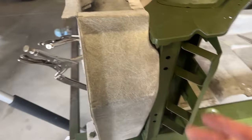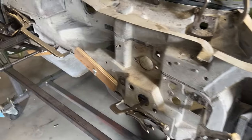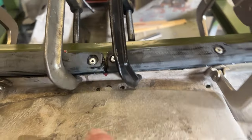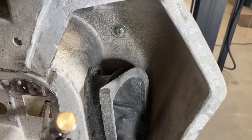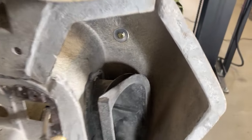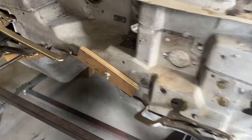I had some issues with this being located left to right in the proper spot because I replaced the lower windshield and lined that up with all the dash bolts, which made this hole here off a little bit. I had to make that more of an oval so the hole would match up because I had to move the firewall over to match up with the original holes and where the washers were. You can see that washer's right around the same rust ring as the old washer, so it's in the original location — which is what I was attempting to do. Really happy with this.